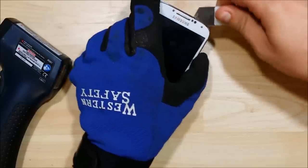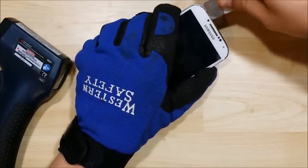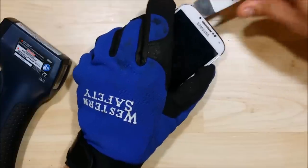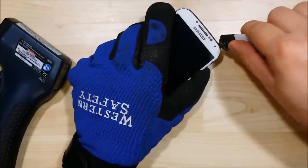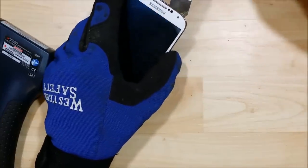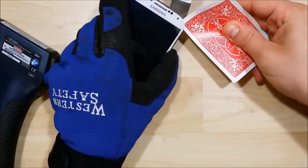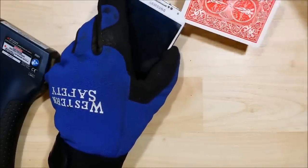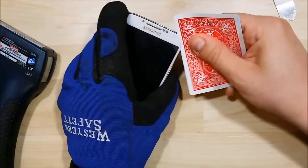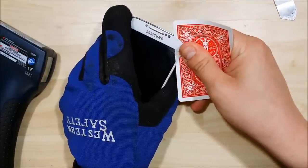The goal here is to break through the black rubberized tape that's holding this frame. I'm prying up right in the corner — you can see that the optical clear adhesive started to spiderweb out on the phone. Moving to the other side to get the same effect. Since we have a little bit of a gap here, I'm going to insert a playing card into the phone and remove my metal pry tool, then slide it down to start getting the optical clear adhesive to break away from the LCD.